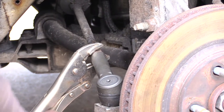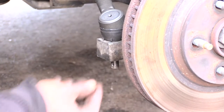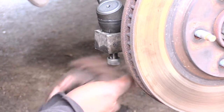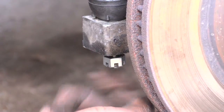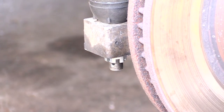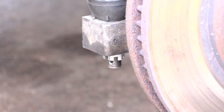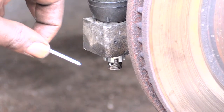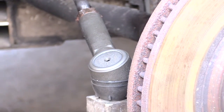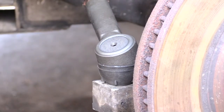Make sure that's tight. Once you have that tight, take your castle nut — it goes at the bottom — put that back on and tighten it up. A lot of them will come with a cotter pin that looks like this; slide it into the little hole right there. Once you've done that, take your grease fitting and put it inside this hole here, then make sure you put your little valve back in the top and screw that in.